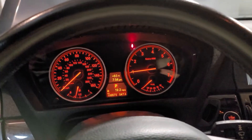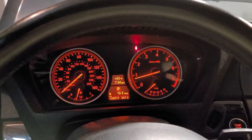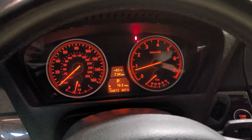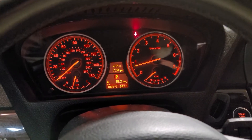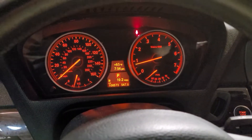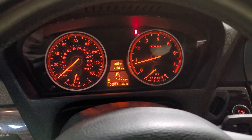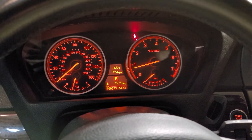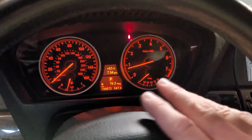At the risk of having egg on my face, I'm pretty sure we got it fixed. Those little pumps just don't last all that long, especially if you go with the off-brand — don't do it. Get the Pierberg from FCP Euro with the lifetime warranty; it's worth the extra money. When you're done, always check for leaks and check your coolant the first couple of times you drive it.